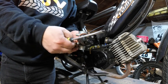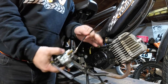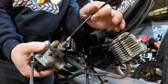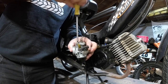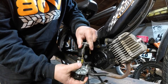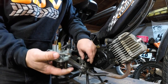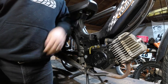Carburetor is detached from the bike. Look at that — way too much RTV. We're still attached via a very loose throttle cable; you shouldn't have about an inch of slack in there. Let's release the washer holding it on and the whole slide assembly should come out. We got our needle, we got everything. That is what we're calling 'custom' in the industry — this is practically useless. Step one: we've got to do something about the carburetor.